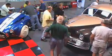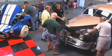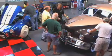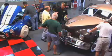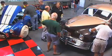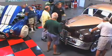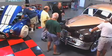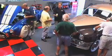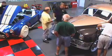And then after I tested my first product, I would pull the tape line back and look on both sides, and I would be able to see if I was getting the defects out. If I was, I knew that pad on that product was going to get the job done. If it wasn't, then I knew I needed something more aggressive. You usually start out using something very non-aggressive, because the philosophy is to use the least aggressive product to get the job done, because you'll leave the most amount of paint on the car. And then you just continually get more and more aggressive.